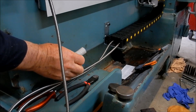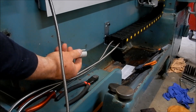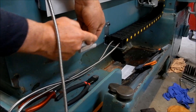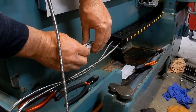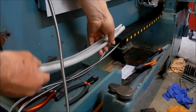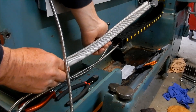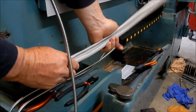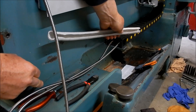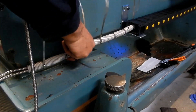I'm going to put the flexible conduit around this cable to protect it, but slitting it down one side was nearly impossible to open up. So what I've done is cut halfway through the ribs from the top — just continue cutting through — which creates a clamshell that can be buttoned together. I'll feed that on and close it up and clip it together. I reckon that's going to afford it quite a bit more protection as it comes out before it goes onto the cable tray.